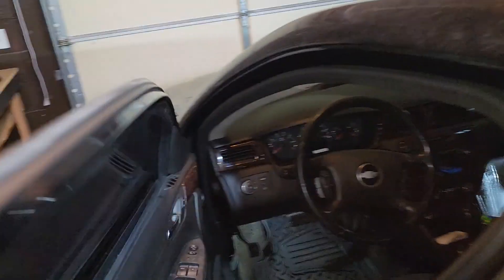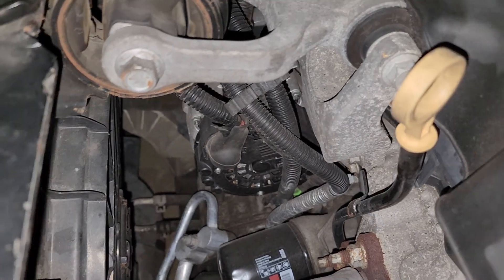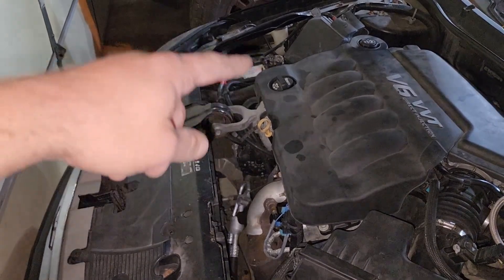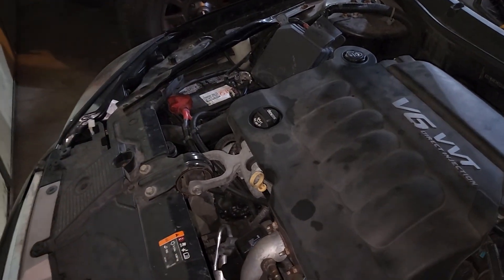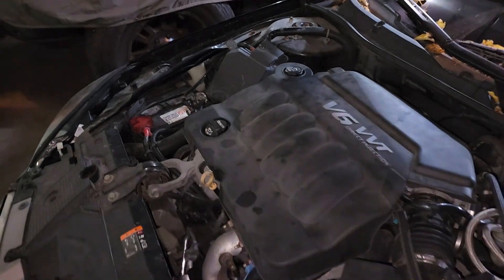Right now everything is super stock under the hood. The plan is we're going to be doing a 270 or 300-amp alternator. Obviously we'd be doing the big three — going to the battery, grounding everything. I'm probably going to ground the alt to the battery and then battery to the chassis, then probably run straight off the battery back. I got six-spot terminals right now for this battery but most likely it'll be swapped out for a D3400. Pretty much got everything else done other than the alternator and zero gauge.